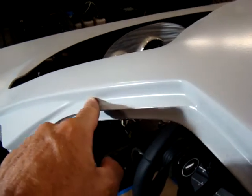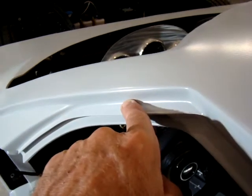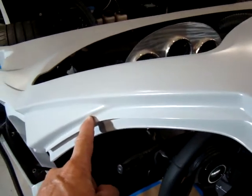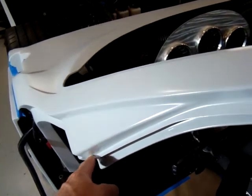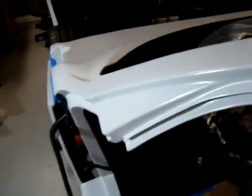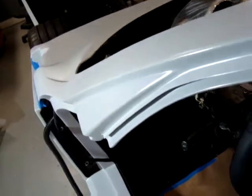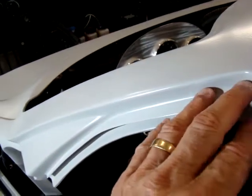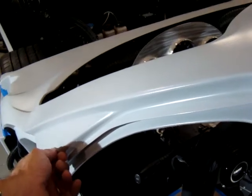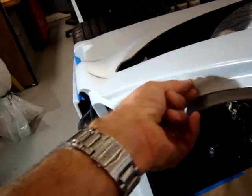And I'm talking like 180 grit when I first hit these after I fill them, and then progressively less, and then ultimately with one of those 3M sanding blocks, you could literally press that 3M sanding block right into that thing and just press it in there. You don't really need to worry about rolling it like you do the sandpaper. The sanding blocks conform to the radius, all the way around it from start to finish, and it'll just sand that whole area down.